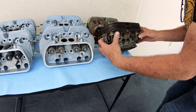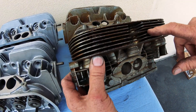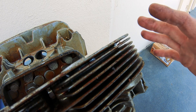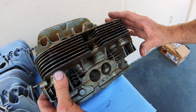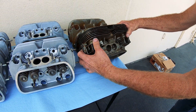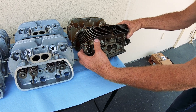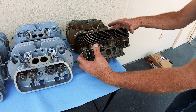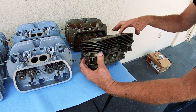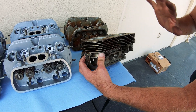These are what I consider early model 041 — inside here you have what I call the chamber jacket. It's not built up, so basically if you want to fly-cut them down, say to 250 or down to the spark plug hole, you're better off using a smaller bore like a 90.5 or an 88. You can put 94s on them if you leave the fly-cut there. You cannot plunge them down because it will break through — and of course I know how to weld all that, but that's a different story.